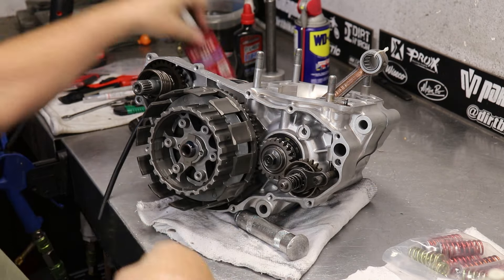Getting some assembly lube in the cylinder — a lot easier putting this stuff on when it's on the bench. Right there you're making sure that that arm is lined up perfectly with the power valve in the cylinder. I've seen guys bend those over the years, and I can say that back in the early 90s — like '92, '93 — I think we actually did one. It's a pain to get it fixed, buy a new arm, or get that one welded. So make sure you're lined up as that cylinder goes down onto there.